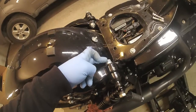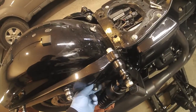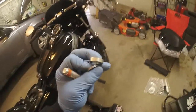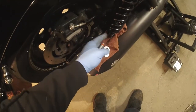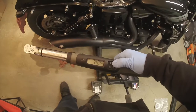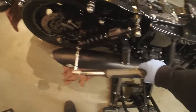Before you slide it on: bolt, washer, shock, the new mount part — then slide that through, use the thickest washer and then one of the new hex nuts on the other side. Using two 19mms — closed box on one side, socket on the other — just snug it so the bracket stays in place but can still move by hand. For the lower shock bolt, they supply a new bolt. The upper washer is the thicker one that goes behind the jam nut; the thinner-but-still-thick washer goes between the shock and the fork. The new bolt is a 5/16 Allen head. Torque for the lower shock bolt is 35 to 45 foot-pounds — I'll go 41.